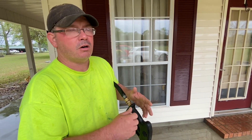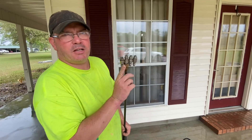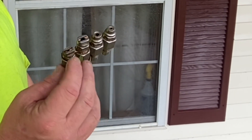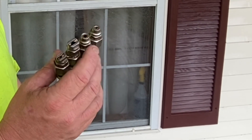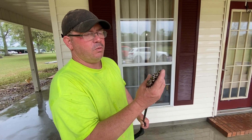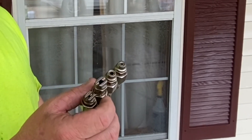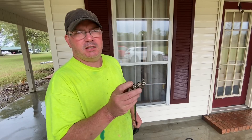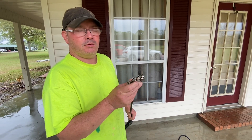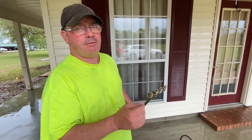There are a couple of ways you can do it — with a water hose, which is great, or with a ball valve, which is awesome too. But I'm going to show you my technique. Right here I have on my gun a J-Rod. This J-Rod has several different tips to choose from: a fan tip that gives out a lot of pressure, a fan tip that gives off a little pressure, and some straight streams. We're not going to use those or even the tight fan tip for this rinse. We're going to use the softest fan tip available on the J-Rod — equivalent to an open ball valve or a black tip on your machine.